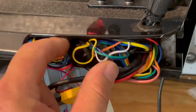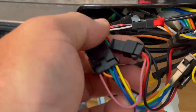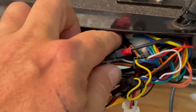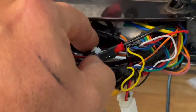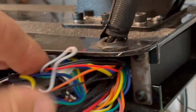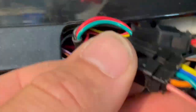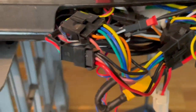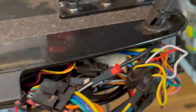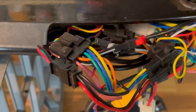What I did was poke the cable out this side and then slide it over the top and poke it through there. Quick tip: disconnect the cable, feed it through, then reconnect it out here and push it back in. Now we've turned this around we can get in here a little bit easier. These are the three wires coming from the immobiliser with its set of connectors that tap into the original connectors. Up here we have another set of connectors for the key ignition - that cable heads up to the key ignition, split between this connector and this one, so we're going to disconnect those to eliminate the key ignition.